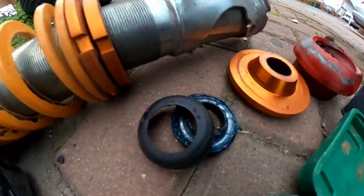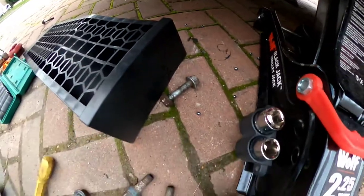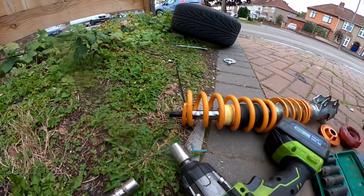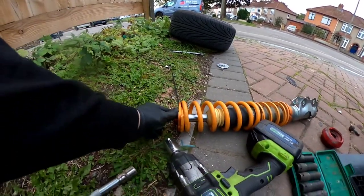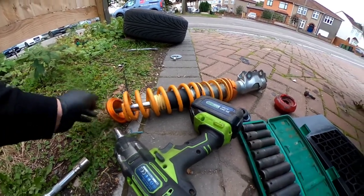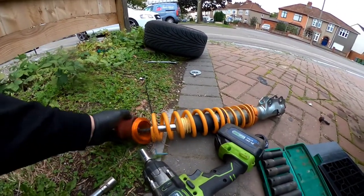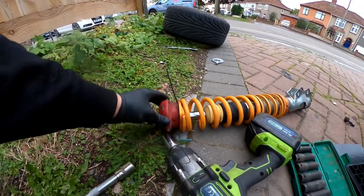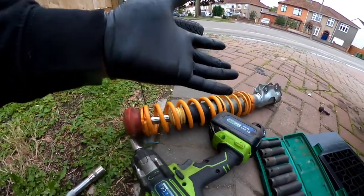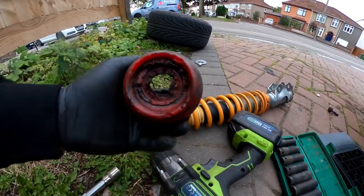It just fell apart. The bearing is completely smashed through. Literally just fell to pieces, the bearing and the coil. So, yeah, bearing over there, this one just fell apart. It's pressed in on top of here and then held in by the rubber, which has also been pretty messed up by the bearing. But that was on there like that. So that was what was happening, these springs were getting caught. They still didn't give you the right stuff to do with coilovers, so not a good end to cheap coilovers, but back on to the decent ones.